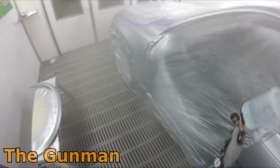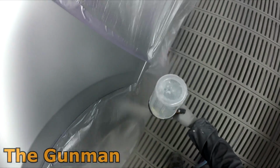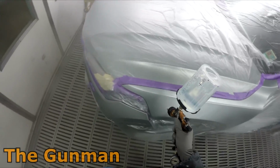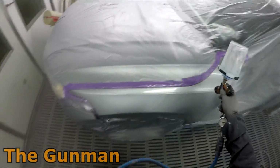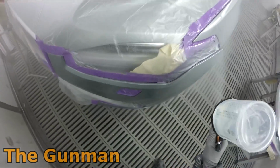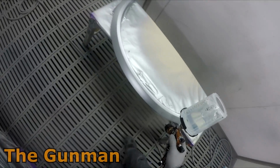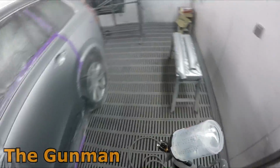And if you're going for flatter, glassier finishes with less thick orange peel in it, at the end of the day, you're always going to get some sort of orange peel in your clear coat. I found at least some sort of a texture to the finish, you know what I mean? Orange peel seems to be a bit of a loosely defined term, I think. You might say, oh, I've got orange peel in this job. Well, what do you mean? Do you have a really thick finish with lots of material, or a dry peel? So I just have found that this gets the factory finishes easiest.